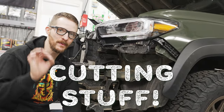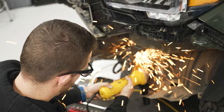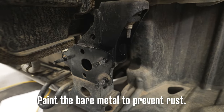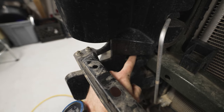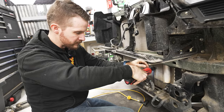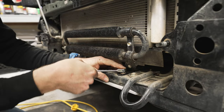On this job we don't have to do a lot of cutting, but we need to do a tiny bit. On both sides, we have to cut this little piece that bends out so that the new bumper can come in and sit nice and flush. We also have to trim the air dams on both sides — a simple cut on the driver's side and the passenger side. Before fitting the new bumper, we need to relocate the power steering cooler: remove the two 12-millimeter bolts that hold it in place and the 12-millimeter bracket bolt holding the line on the passenger side. Use CBI's supplied relocation brackets and hardware to secure the cooler closer to the radiator.